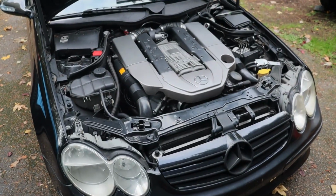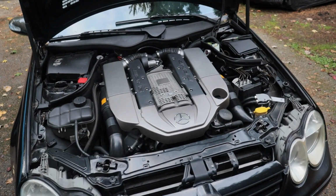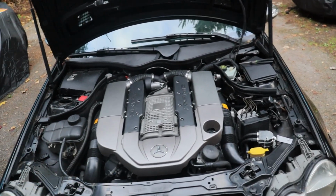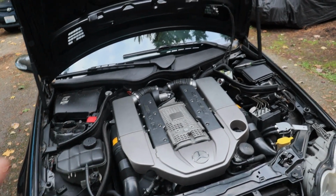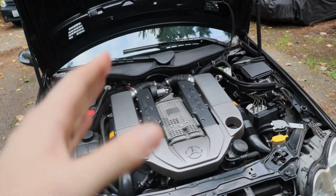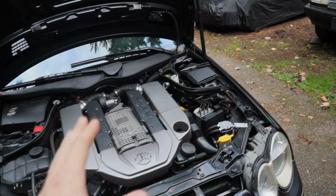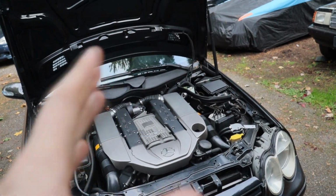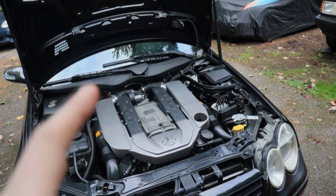Alright guys, well, maybe you just saw from those clips in the opening, we took the car on a big adventure today, the CLK, and honestly it did great, but there's still some issues that we need to sort through. The primary O2 codes came back, it popped the fuse again, so there's definitely a short circuit somewhere in that wiring, so I need to really go through it and double check what splices they did and redo them myself and make sure they're in really good shape.